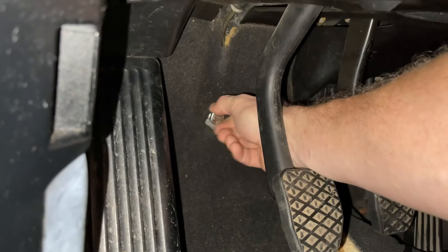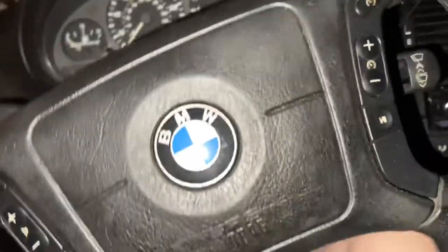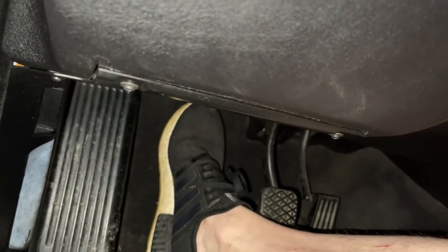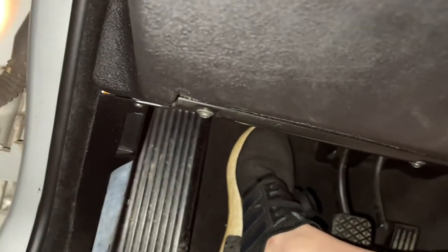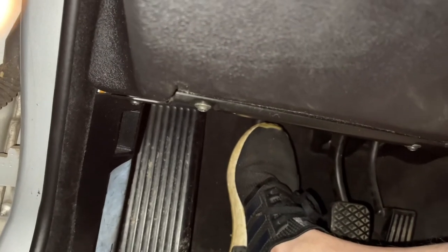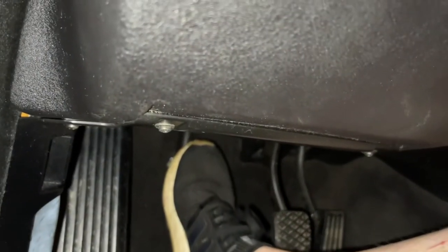Now I can use one a little bit longer because I think this was just shorter than 1.5 inches long. The guy on the video said 1.5 inches long on the bolt. But then when you lift your clutch, I'm just barely going to do it. I'm going to stall it. See, it engages right there instead of having to wait for it. You're about 3/4 inch off the floor when you press it in, so you're saving that, and it engages so much quicker.